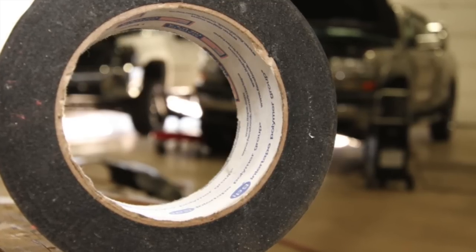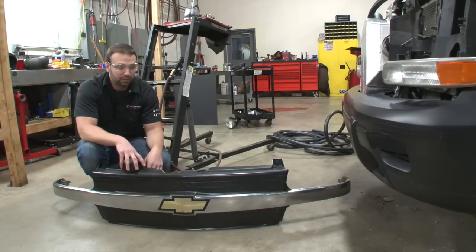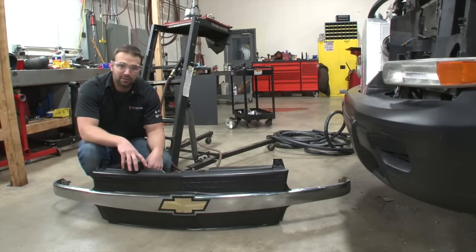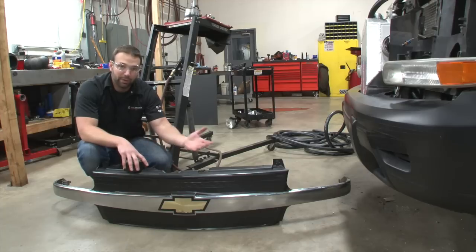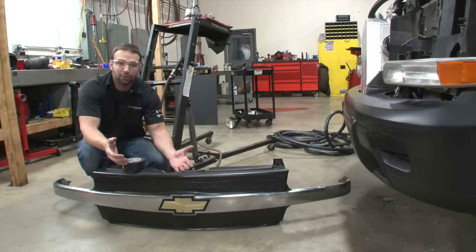If controlling the coolant temperature is an issue, then we're going to start to peel back and allow some wind to get through and cool the truck off. But we can always let off on the first few passes if things get a little on the warm side. Remember, we also do not have an air-to-air intercooler up front, so there's no reason we need to let air through other than to get to the radiator.